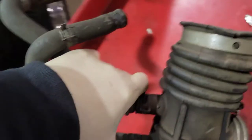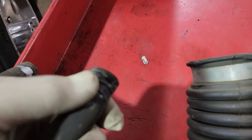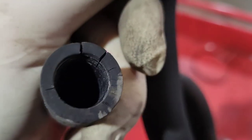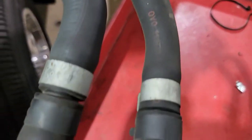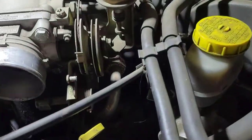I'm going to lube it up and try to get it back on — it didn't break all the way through so hopefully it'll be okay. The air injection hoses did break and split. What happens is if you wiggle them side to side and pull back you can get them off, but the problem is they split, so when you push them back on they break wide open. This is common on anything older — Toyotas, all of them do it.